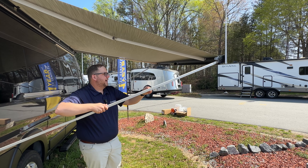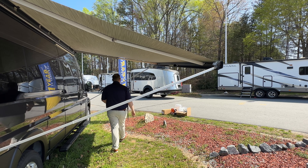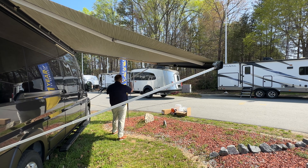First thing I want to do is lower this side down, then lower this side down — it's very light. This part here just lifts up and the awning can come out. From here, I want to get this channel facing up. I'm going to turn that up and put it right in, and then it folds into place. We're going to lift this upward, then lift it right out. Hold near this because it will slide into the side of your motorhome and scratch it up. Then this opens again — you want the channel facing up — that allows you to fold this in.